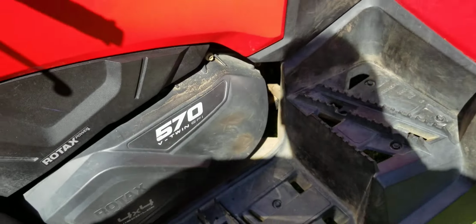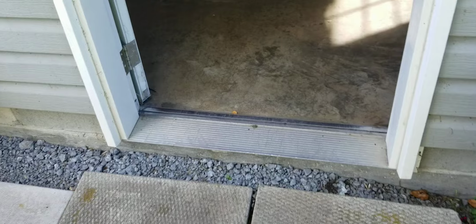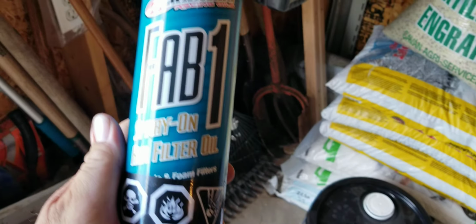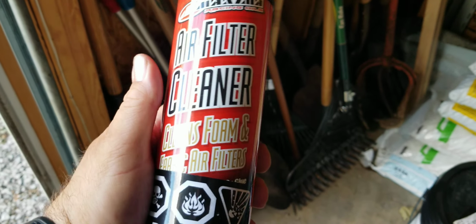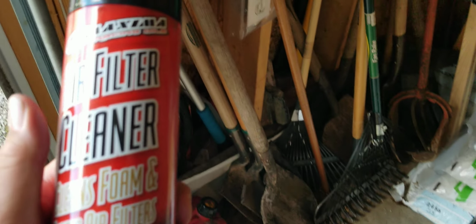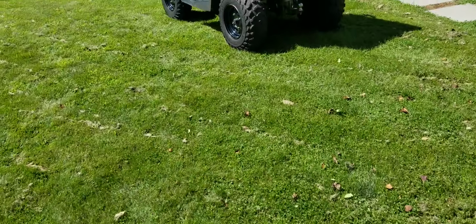Oh, let's see if I can find the stuff I use for the air filter here. Follow me. So the air filter stuff is literally the stuff you get from the local dealership. So here is Fab 1 spray-on filter oil. It came in a 2-pack for like 20 bucks, and then air filter cleaner. And this is only for the foam that's on the outside of the cartridge. The cartridge, all you need to do is blow it off with an air compressor, blow it out from the inside out, and you're set. What else is there? I think that's about it.